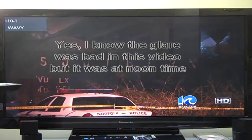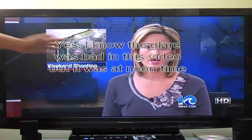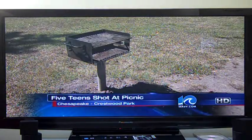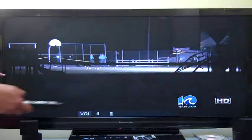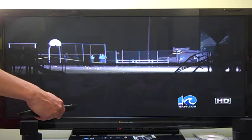That's the matrix you're going to be adjusting. To get into the service menu, on the TV, press the volume and hold it down, and then as you do that, press info three times — one, two, three.